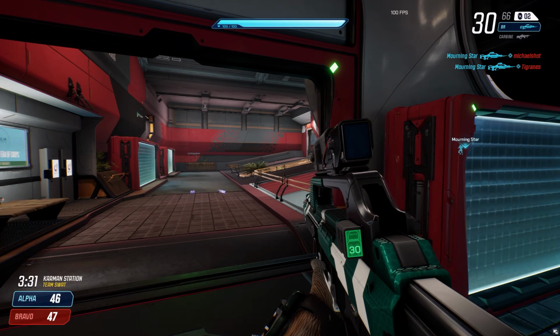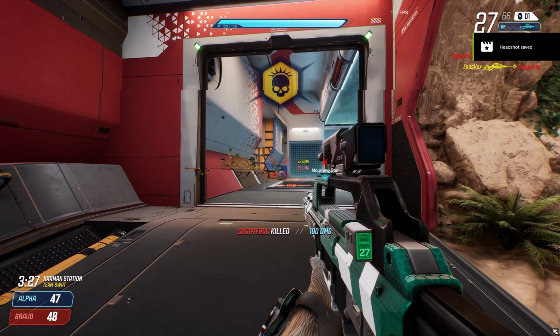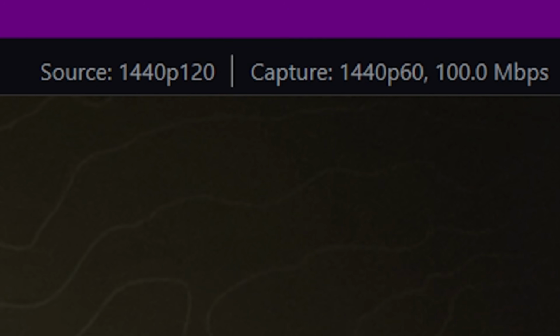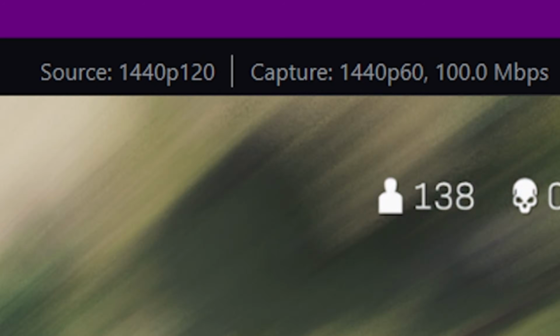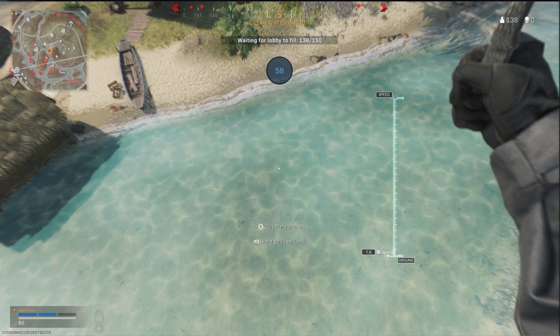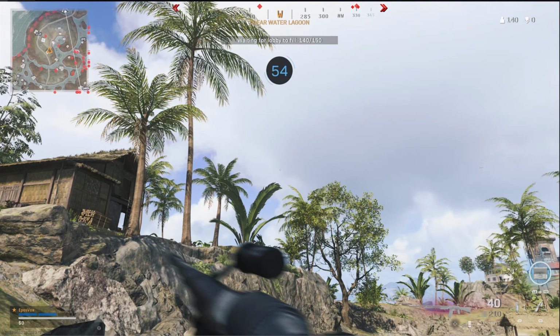With VRR enabled on your console or PC, the source format listing and 4K Capture Utility will actually change the listed frame rate dynamically as it changes in-game on your system. This is really neat. If you go over 60 FPS, obviously it's sampled down to 60 for your capture. If you go under, then you'll have duplicate frames in your 60 FPS capture. It's not magic after all.